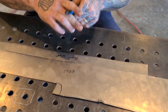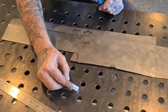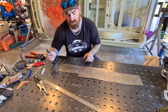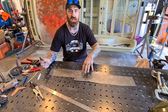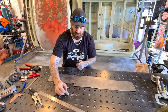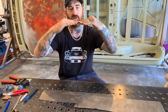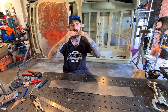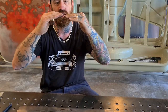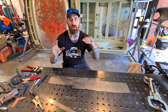Same applies when you put a new patch in — if it's very narrow, the new patch is going to warp as well. Another thing when designing your patch is actual fitment. You don't want them butting up hard against each other because when they heat up the metal has to go somewhere. The metal will start to roll when it expands, so leave yourself a bit of a gap. Don't leave too big a gap or you'll have issues bridging it. I'll show you how to bridge a gap only if you can get behind the panel; otherwise you're better off starting a new panel.